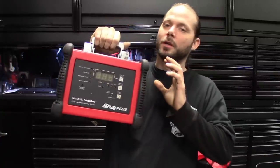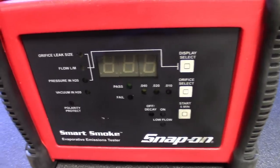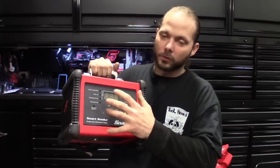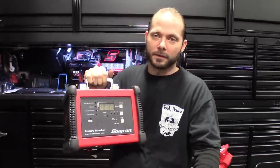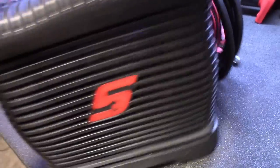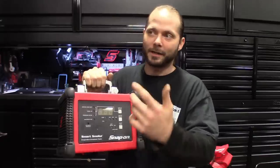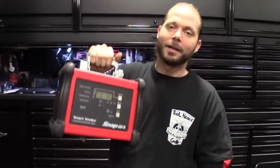It's a great smoke machine — pretty much plug and play, ready to go. Powers up as soon as you turn the button on and there's smoke everywhere. What I do like about it is you can also check vacuum on the systems. It also self-calibrates — you plug this thing in, put it on a car 2000 and newer, which would be 20 thousandths, and it does a leak check for you, giving you a digital readout of whether you have a leak or not. If it passes, it'll just show 'pass.' It's also got a low flow setting so you can dial the smoke back and pinpoint really small leaks.